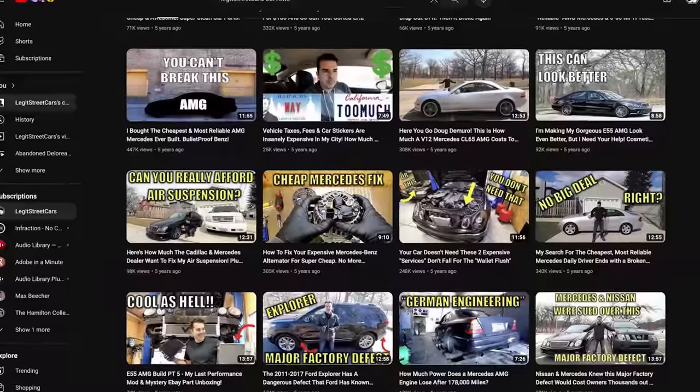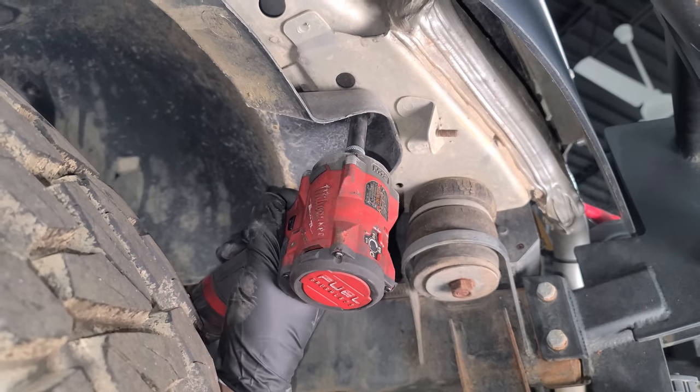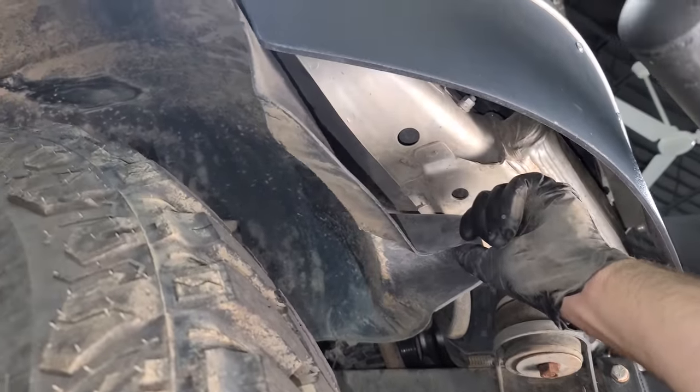Now, if you guys have been watching the channel for, you know, 5 or 6 years, I did come out with a video on the Mercedes, specifically on this type of engine, and the voltage regulator at the back of the alternator can go bad, and that's like a $25 part. So let's check that. But either way, I think it's time for an alternator at this mileage. It's just making too much noise. I haven't done an old ML alternator in a long time. But I think if we get this fender liner out of the way, it can come out this way.